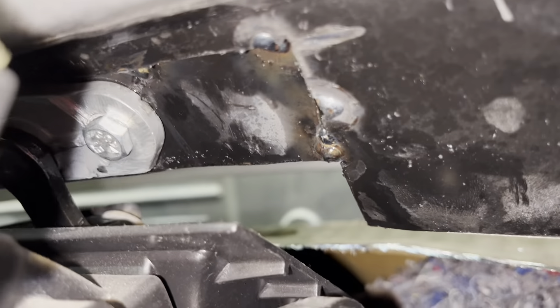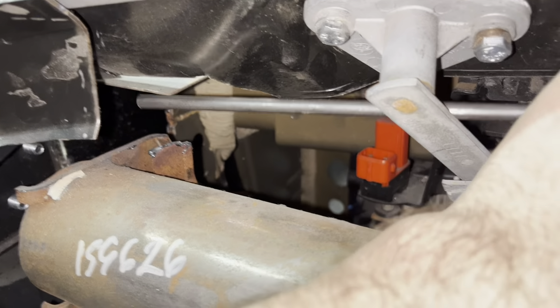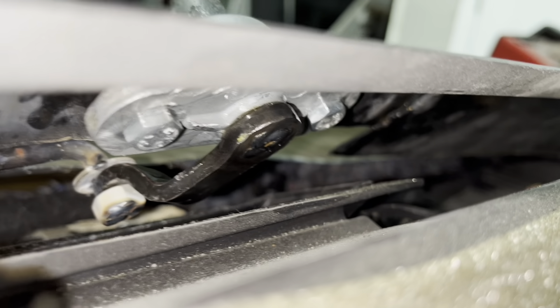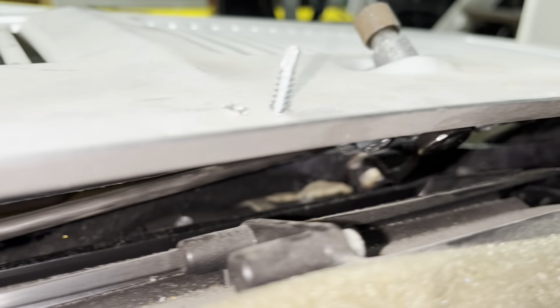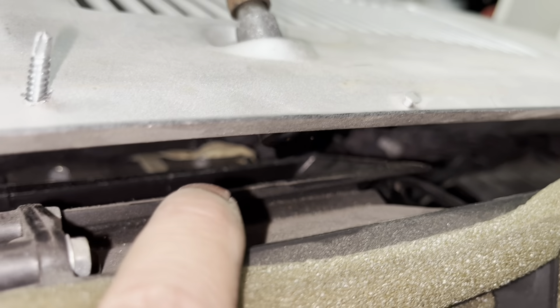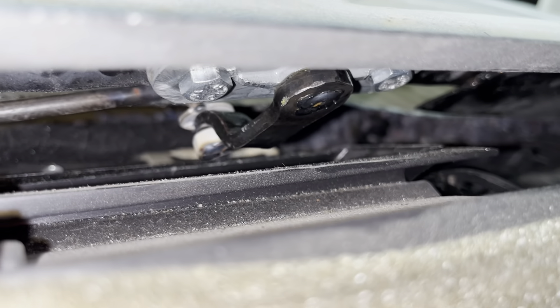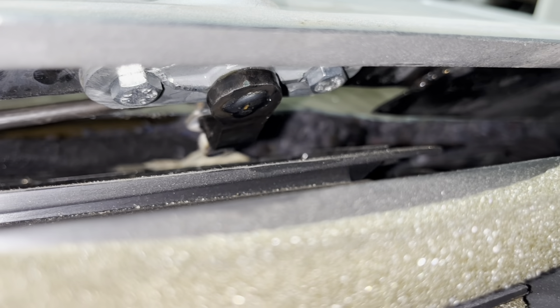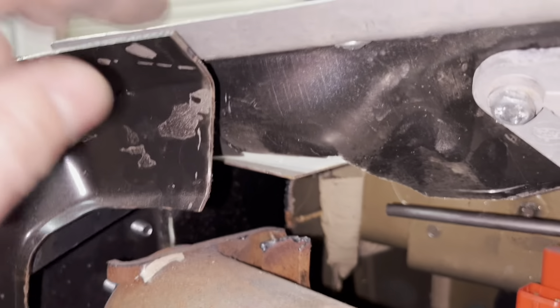I regrouped on the way I've done this. I still have a factory one on this side for now. I've used a five-sixteenth inch rod and made my own bracket up in there. As you can see right there, it does operate just like it should. I've used that little quarter-inch plate and made a little spacer in there. If you look straight down, this piece — the air box — I can build a flat piece to cover up a section of this right where it's going to operate without any issue. It'll be very close, but as you can see it operates fully.